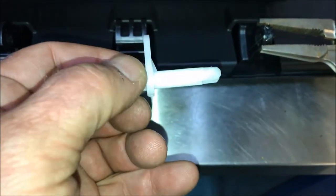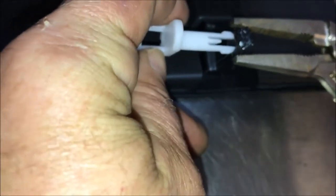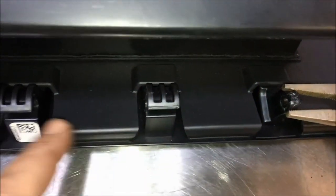So here's the pin I'm talking about. When this pin is in the vehicle — at least the way this one was assembled — this tab, the tab right here, is facing forward and it's between two pieces of metal. There is no way to get this pulled back to release these two closed loops you can see here on each side. And here's the semicircle for each of those other dowels that go across at the base of the box. So I had to pull the trim back by removing those four screws I've already shown you to rotate this and pull it out. The nice thing is you can put this whole box back in and slide these into place after you have it located on these dowels.